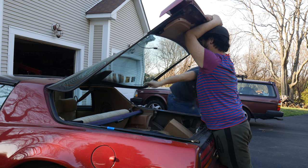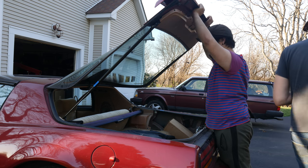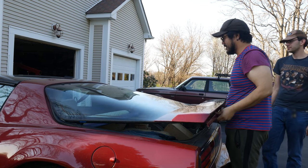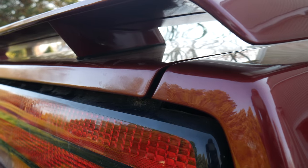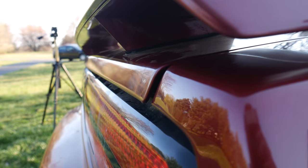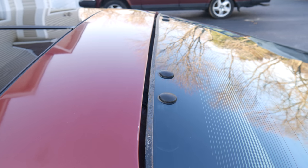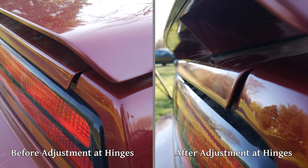With the hatch lifted up and held in the forward position, we went ahead and tightened the four nuts back down. These are kind of scary to tighten since they're going through the glass, and there's not enough room to use anything but a combination wrench while the glass is mounted. I got them as snug as I dared. Then we reinstalled the lift struts and closed the hatch, and immediately the alignment was much better. The gap at the top was a lot smaller than it had been, and while the alignment at the rear still wasn't great, it was a lot better. The driver side is actually pretty much flush, but the passenger side still overhangs a little bit. The gaps on the sides are also passable. This small adjustment seemed like enough to make everything good enough — and I was happy with it for two or three months, until the hatch slid right back where it was.